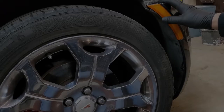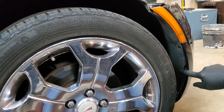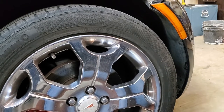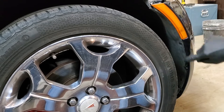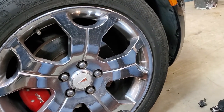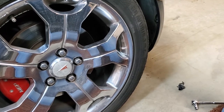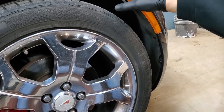We're doing this video right after I've replaced the emblem on the front of the car, so this portion is already disassembled. There are four screw bolts — I've got them down here on the ground — that you have to take out: one here, one here, one here, and one down here. They're seven millimeter. Remove them, and then we'll go around step by step to show how I take out each piece and ultimately install the new fender liner.